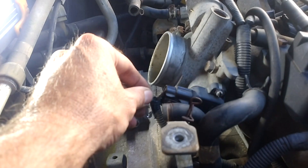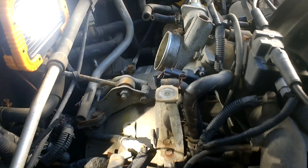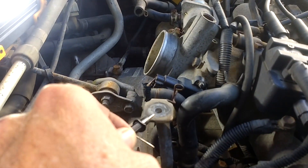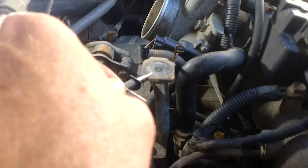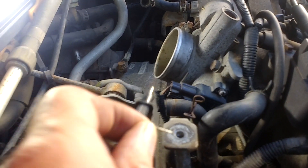We'll pull the safety pin out of the white wire. The other end of the probe — in case I didn't mention it — I just had it grounded right here to the top where the air cleaner was, which clamps directly onto the motor down below. So with a good bare metal ground and the white wire, you should get half a volt DC.